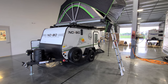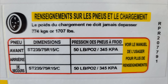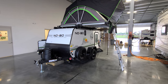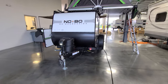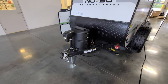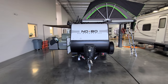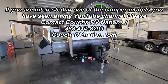The tire sticker tells you tire size but most importantly tire pressure. Do not let the pressure drop too low — the tire can only hold a certain amount of weight at a certain pressure, and if it drops too low the tire could blow out much more easily. Make sure you maintain your lug nut torque and tire pressure — very important. Down below is a battery disconnect, and you also have your seven-way Bargman wiring plug, which runs your running lights, turn signals, and all that. Your truck, if wired properly, should have a 12-volt feed and a brake controller — that 12-volt feed will charge your battery while driving, or if your battery were to die you could use your truck's feed to still use the power tongue jack or charge the battery back up while traveling.